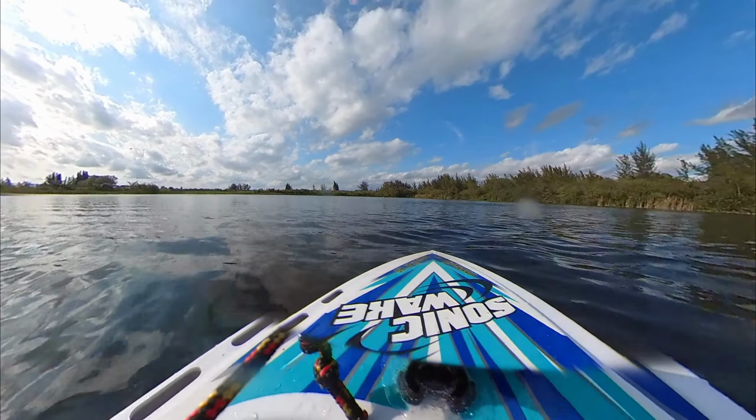44 miles an hour. That's pretty darn quick on the water, guys. Now, no, it's not 50, but what I will say is that the connectors are getting pretty warm. Not these, not the 8mm bullet, not the IC5 adapter, but these. Now it could be the gauge wire and it could even be the connectors or the bullet connectors used here.